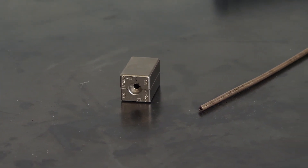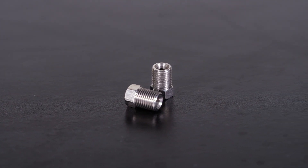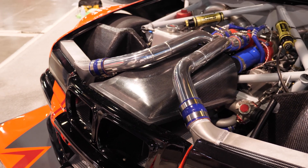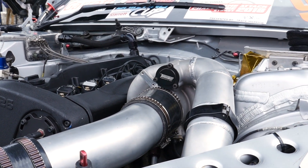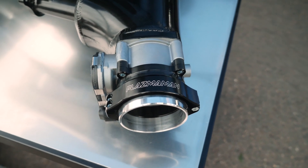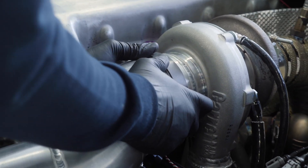The other option with hard line is you can flare it with a flare tool using 37 degree dies, then simply use a tube nut and a sleeve. On the larger end of the plumbing spectrum, we have intercooler piping — large diameter, usually aluminium tubing. In most lower-level aftermarket applications, silicon couplers are used. There will be a boost pressure limit that silicon can take, but with a good solid bead rolled on the tube, silicon can handle quite a high pressure. For higher reliability in high horsepower or high boost environments, clamshell couplings are used — the original design was called the Adel Wiggins clamp.